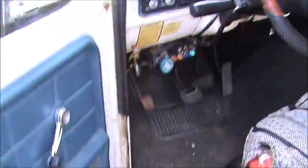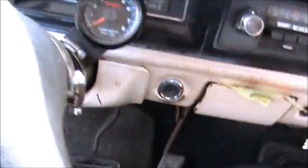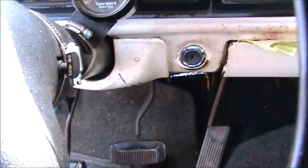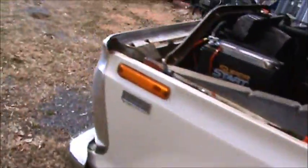Get out to the Arkansas emergency brake. Let's climb in here and see if it'll run. I cut the DuraSpark 2 ignition box — the electronic control module — loose from it. Without it, the truck just sort of shits its pants and won't run, kind of like it was doing. I'm giving it two pumps. Timing's way high — let's get out and back it down. I kind of figured it would be. It was a guess. We moved it quite a bit.